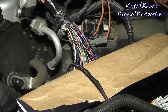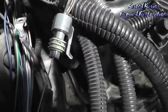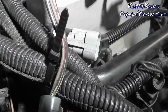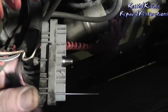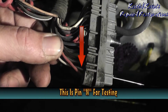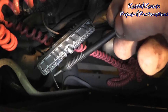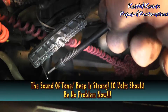We're going to test this connection before we seal it up. I have my sewing needle in for the white-black wire. Right here on the ignition module — you'll notice where the arrow is pointing — that is our white-on-black wire. Now I'm going to do a continuity test: when I touch this and it reads good continuity, we should have no problem with the crank signal.